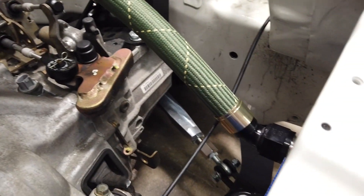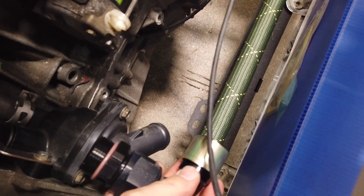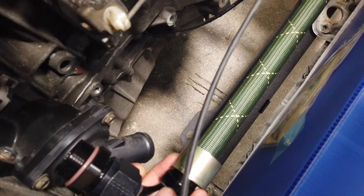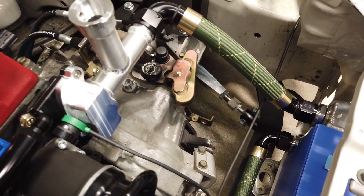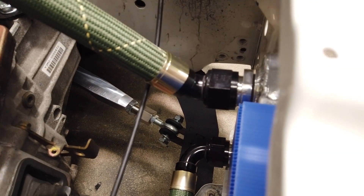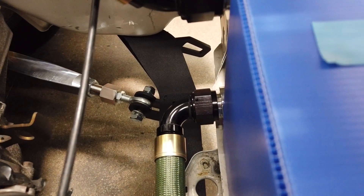Here's a quick shot of our lower hose getting mocked up. You guys can see the lower hose, and when I get to the thermostat housing right here it's going to look something like that — a threaded ORB 16 with a 90-degree hose end threading into a billet water neck, and then sitting onto the hose. Just to get an idea of what the water lines will look like, it's gonna flow out this way to the fill cap, down — our radiator is a dual-pass design that has a divider in it, that's why the lines are on the same side — it'll flow down and in across and then back out the other side, out this lower line.